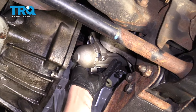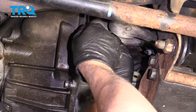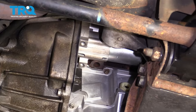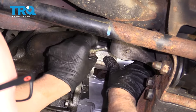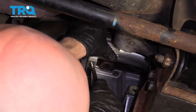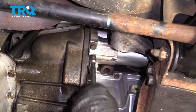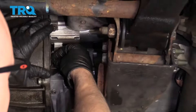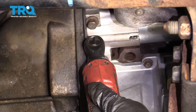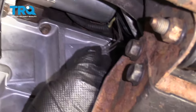And line this back. As you slide this starter back, put this cover in position and get this lined up. Take the two starter bolts, get those started, and tighten these two bolts to 37 foot-pounds. Now put this bolt in for this cover and tighten it down — just snug it up. And the oil-level sensor right here, line the connector up and lock it down.